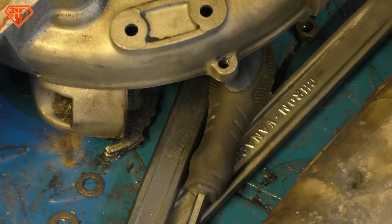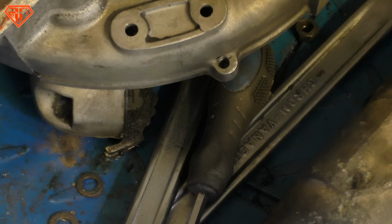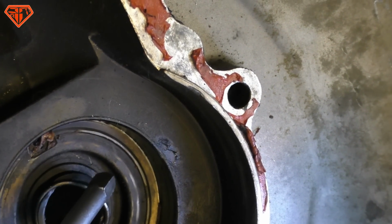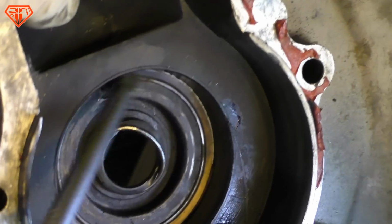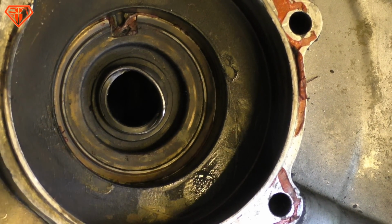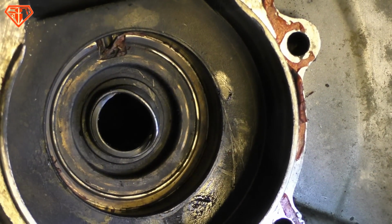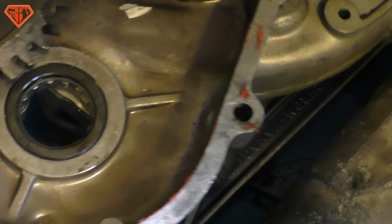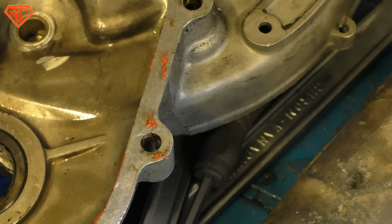But not only that, this poor guy not only had massive false air due to that, because then it's not tight anymore, he also had a gearbox oil suck due to at least too much sealing mass. But maybe these two errors just balanced each other and it was somehow drivable. It did for sure not have a stable idle.